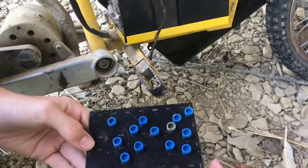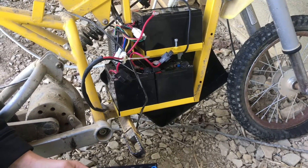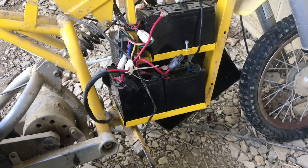Charging it overnight, we popped some caps off. I think it's worth the extra time to go through this process. Make sure there's no pressure in here, because it's super important to have these batteries hydrated. If they're not, you really are going to start deteriorating the batteries.